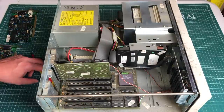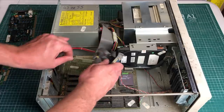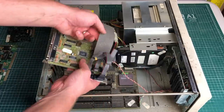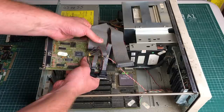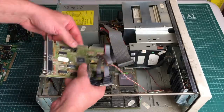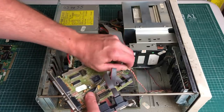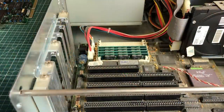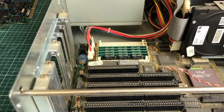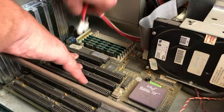Like I said, there was no video card included with this PC, but I do have a spare one here — a 16-bit ISA Trident, a true classic. Next up is the controller card, pretty basic stuff — allows us to hook up a disk drive, hard drive, and has some serial and parallel ports. We also have a cable attached here which is the hard drive LED indicator going to the front of the case.